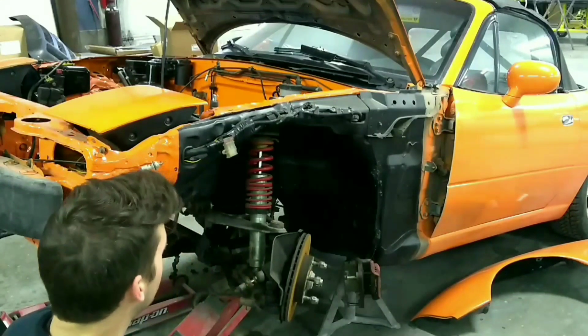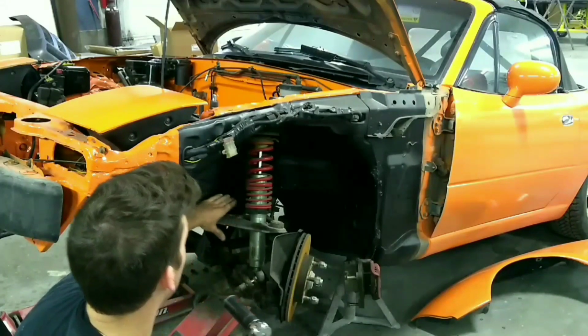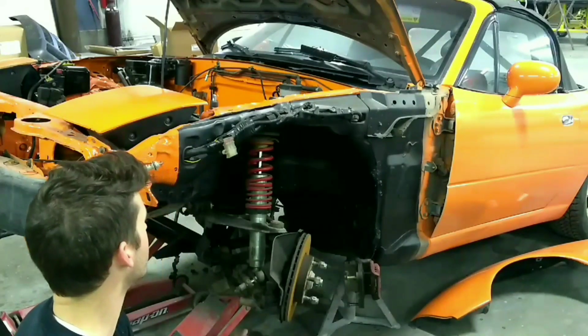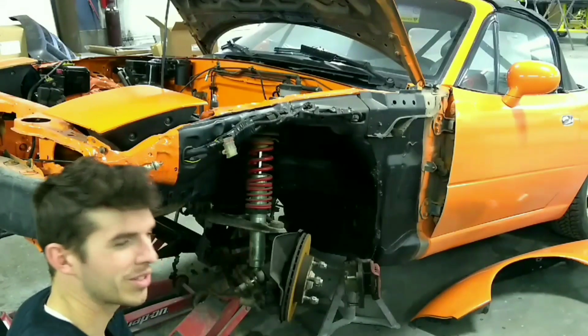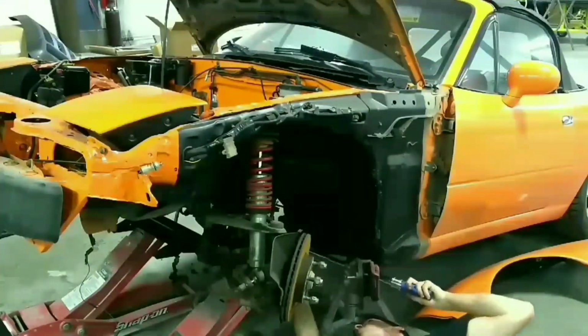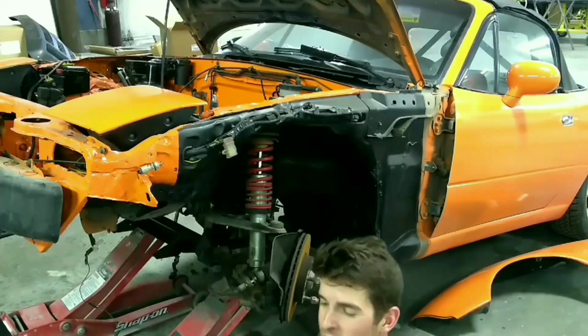So now I'm ready to torque it down. I have all the bolts on snug, or hand tight. So for these front ones here by the strut, I'm going to torque them down to 95 foot-pounds. And for the back 2, 85 foot-pounds. But there's a range, I think, from like 71 to 103 or something like that for the front. So I'm just going to go to the happy middle of 95. And then you repeat that for the other side.